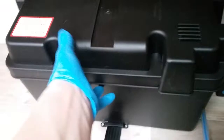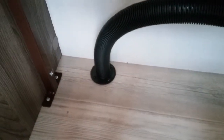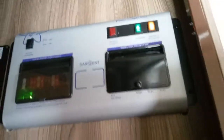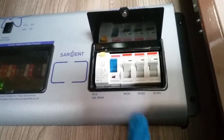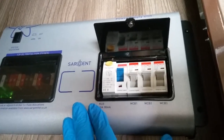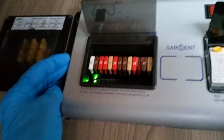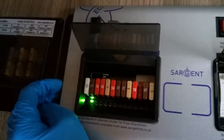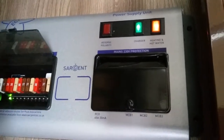Beside this we then have the leisure battery just here. Where the gas comes in and then drops into the tank underneath the van. And then we also have the consumer unit — we have the mains trip switches just here, all the individual MCBs just here, and the main RCD and test button. And then here we have the 12 volt fuses. These are all numbered up as well, exactly the same as the trips, and will correspond in the Autosleeper handbook.